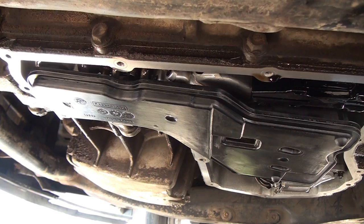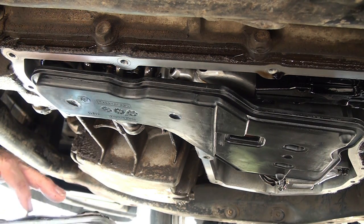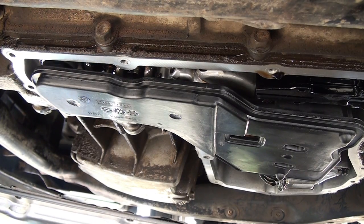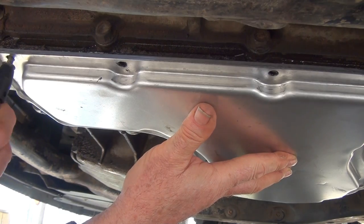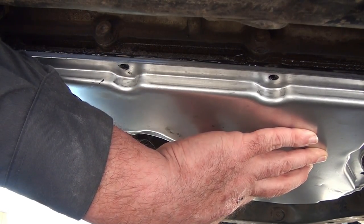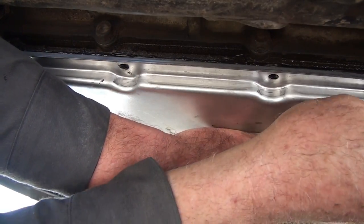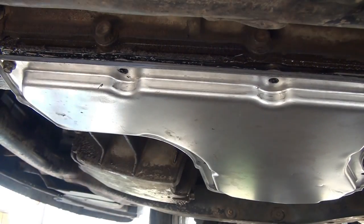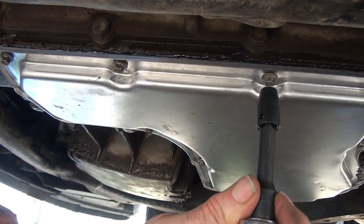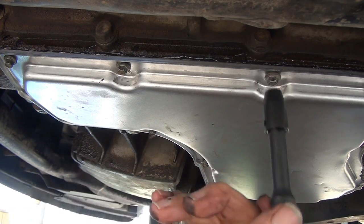Now it's time to go get the pan. This is the critical part — holding your pan up there. Like I said, I did not get the stock gasket for it, so I kind of went old school on the gasket, which means I have to hold it up with one hand and screw it in with another. You want to get all your screws started first to make sure the gasket is lined up. Sometimes if a screw doesn't start, the gasket is in the way and you can use an awl or a punch to center it. Now I'm going to put these bolts up with just a little tension where I feel them hit the pan and start to tighten.